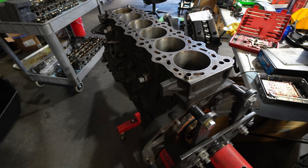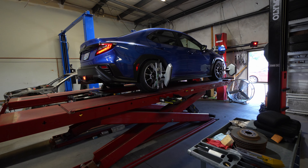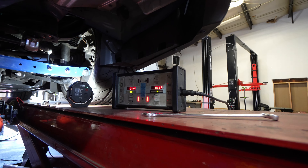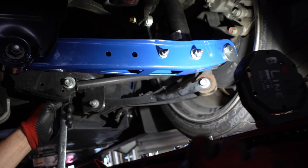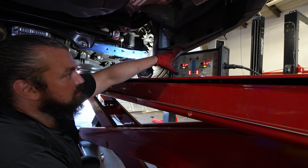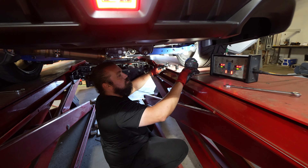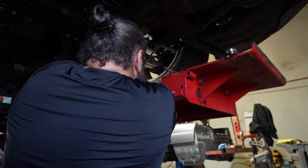Goals — future goals. This is Nick, he's the owner of the shop, getting the suspension alignment all dialed in for toe and camber. I really should have gone with some adjustable arms here so he's a bit limited as to what he can do, but he's still getting it within spec — about one and a half degrees camber and a little toe in. Numbers are jumping around but it should be pretty close. At least it's all in factory spec. We got the rear all dialed in and Nick's getting the front sorted out.